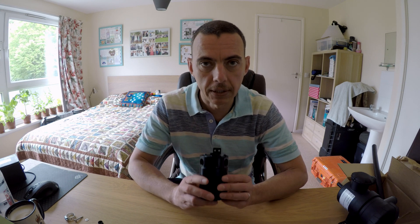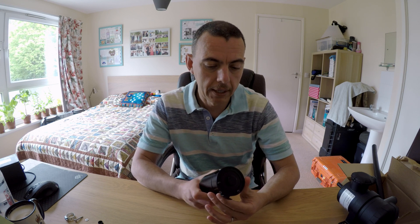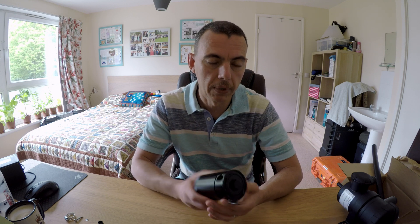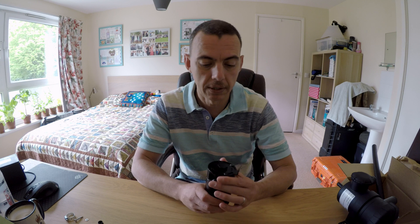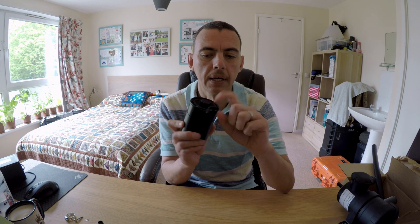This catch can has one outlet and two inlets. I'm assuming if you've got a V motor like a V6 or V8, that is why you would need two of them. It is however sold as a Ford Ranger catch can, so I don't know why we have two inlets. It comes with a bracket that you can fit to the side of your vehicle and adjust the orientation of the catch can by loosening two button screws.